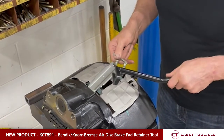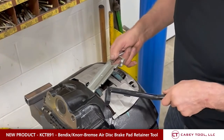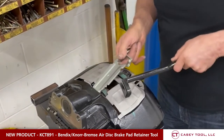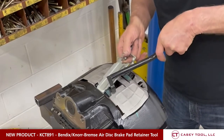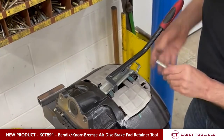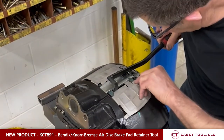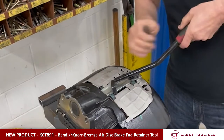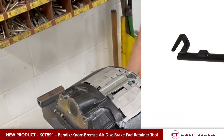There's a little bit of a difference with the shield in place — you can't get up in here in the front, you're going to have to catch it behind, right about here. So you put it together like that, then push down, install your pin, lift up, rotate it, and kick it out. That's it.